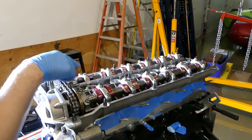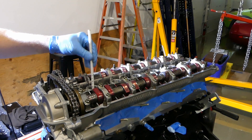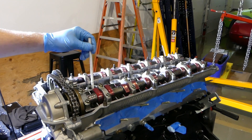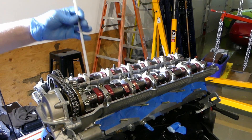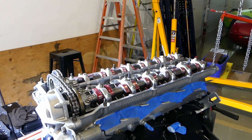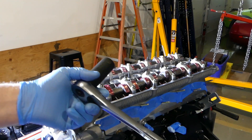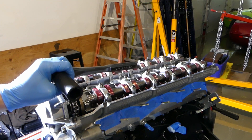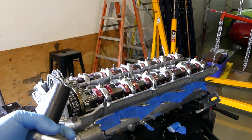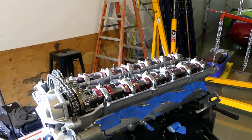And they did align. I came back up and used my TDC ruler, which showed me I was at TDC — the line down here means TDC, and that's correct. That looks good, but the first time I tried to turn it through with a 22 millimeter socket on the crank bolt, it was very hard to turn. I got concerned and stopped, wondering if something was too tight or catching. Then I realized I had the spark plugs in, so I was fighting compression.